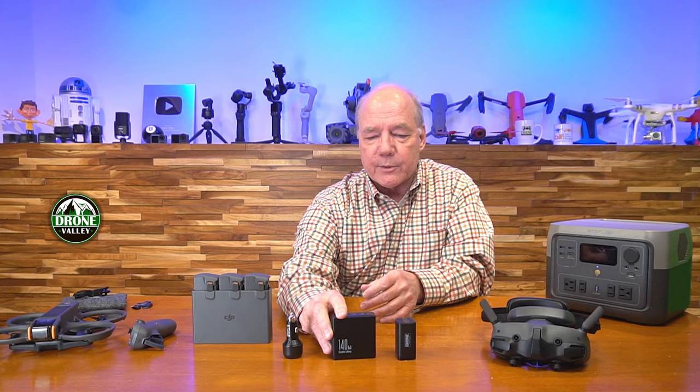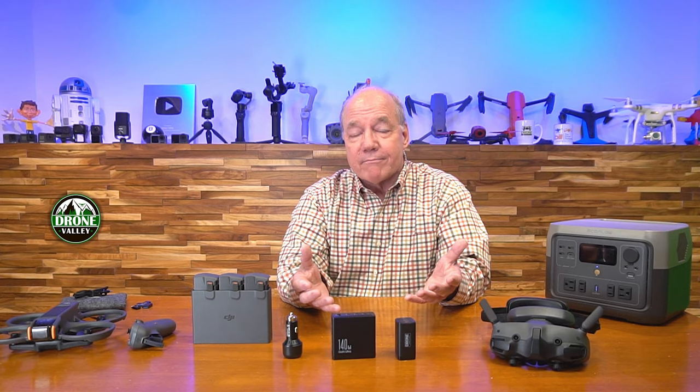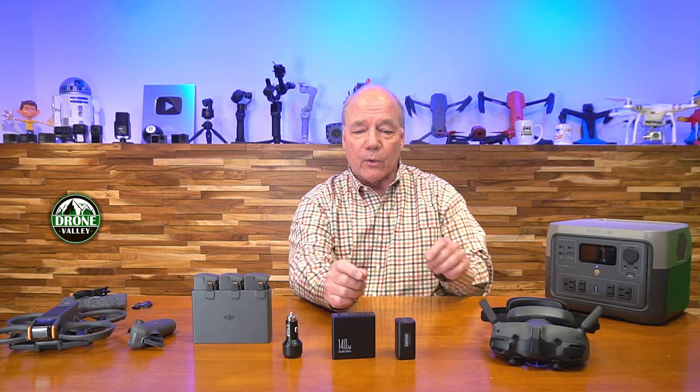And that's where I'm going next, because not only is the charger important, but the cable's super important as well, because even though a charger may be able to supply 65 watts of charging power, if you have an older cable or a junky cable that can only handle 15 watts, guess what? That hose is too small to carry all that current to the device, so you're artificially limiting the amount of power that's getting to your device because the cable's too old.